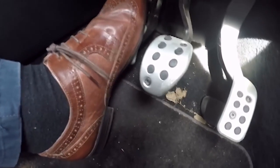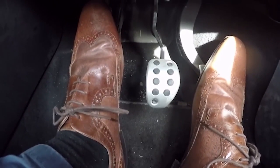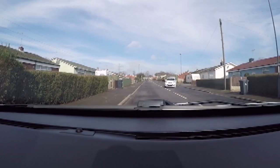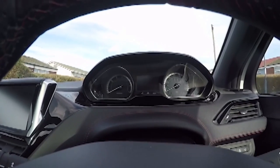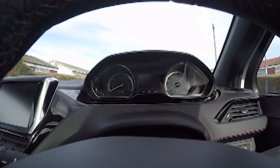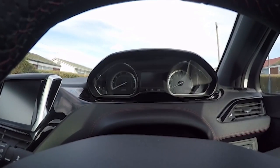Really have a play around with this. When you find the appropriate bite, ready to move off - or prepare for the gradient. Always think about the gradient, whether it's uphill, downhill, or flat, because it's going to alter the way you set your feet. Take a look at what the bite point should look like from the front of the car - I call it the tug point, because you'll see the front of the car tug forward slightly. Also note: coming off the gas slows the car down too, and the clutch can slow you down in slow-moving traffic.